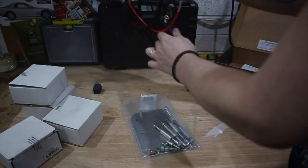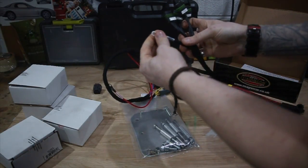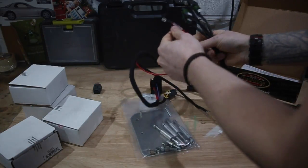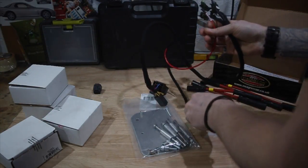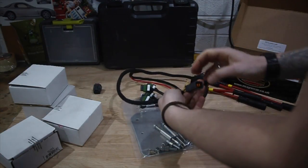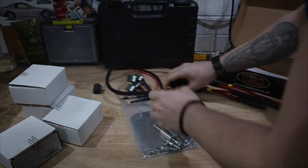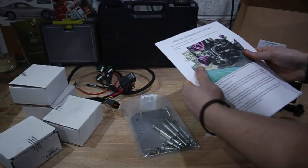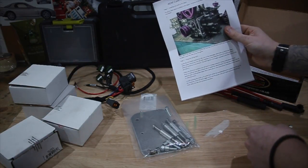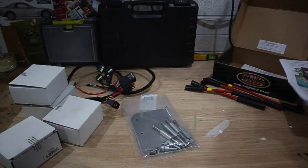And it's even labelled on the wiring loom. That's your earth for your sensor, 12 volt, and your main earth, either to the chassis or the engine. And this is the plug we need to pin, but we'll get to that later on. So first, looking at the instructions, it recommends that it's best to build the coils onto the bracket and then fit it to the engine.